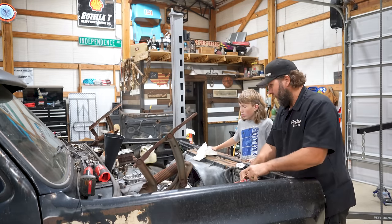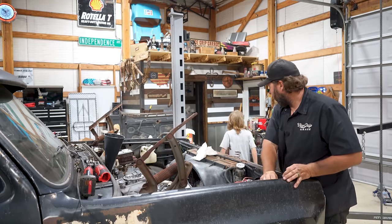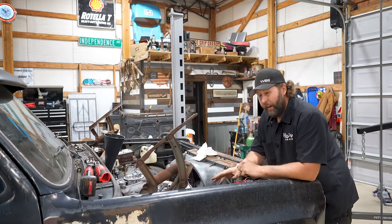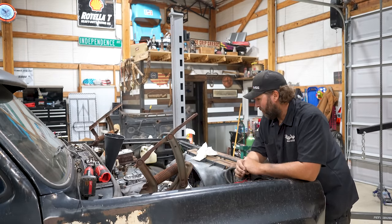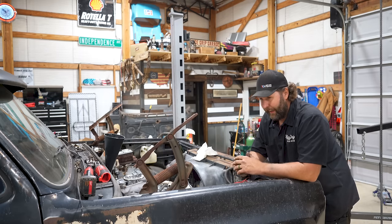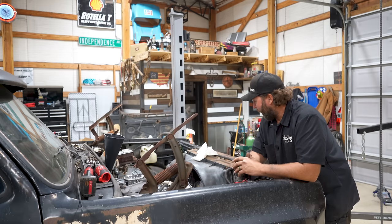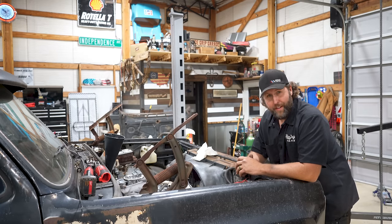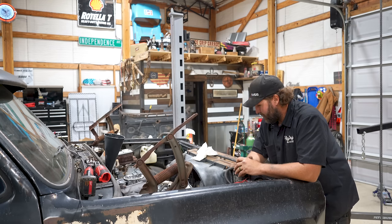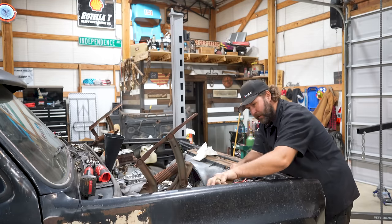Okay. Find that transmission juice. It's in the back of the volunteer dually. We'll fill up the transmission. I don't want to fire that with it empty, burn up the pump. We don't have the right doodabs or whatnots to plug up the cooling system tonight. I can get them in the morning, but we're going to at least try to fire it right now. And whoever put the upper rad hose on, despite all the efforts to save on it, I think I'm going to have to get another new one. It's too short, basically.